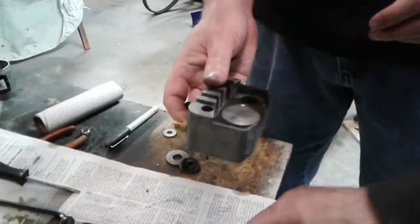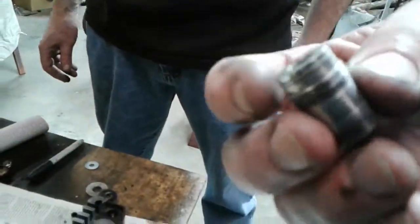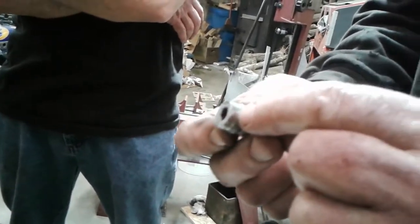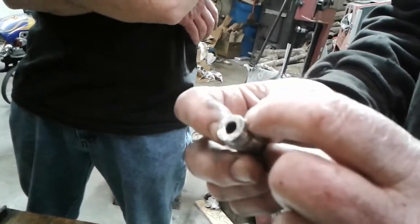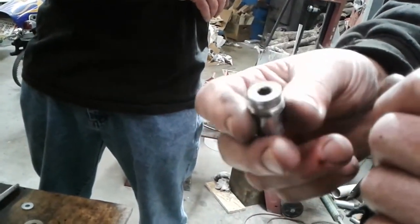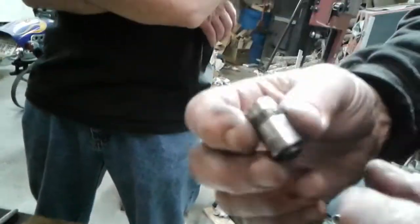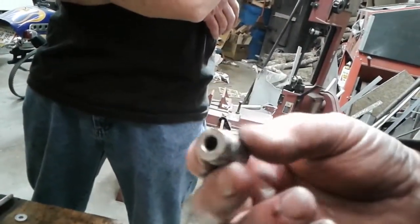One thing I want to mention, besides the fact that you should have a set of those O-rings with you when you go to the track, you should also buy one of these adjusters. The reason why you buy one of these adjusters, I've had like 3 of them go bad. This little shiny cap is pressed down into this part that's threaded. And I've had like 3 of these come out of there, and when they come out, you can't adjust your caliper unit anymore. And if you're at a major race or something like that, and you need one of these, you don't have one, you might not find one because nobody else is going to have one either. Only somebody like me might. So, not a bad idea to have one of those. Not an expensive item to have in your parts.